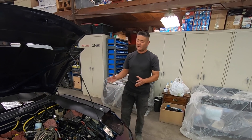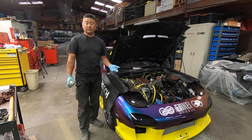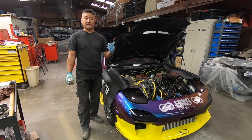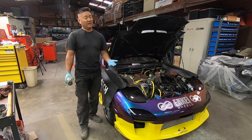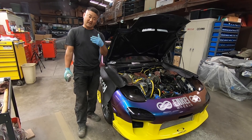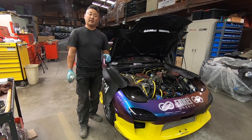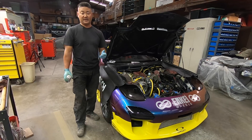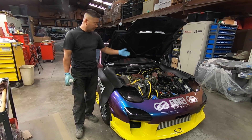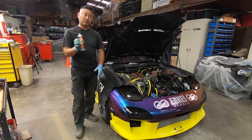Now what we want to do is go through the process of preparing to see if we can get the engine to turn over. The big question is: will the engine turn over? None of us know. In late night conversations, Abel and I have both theorized that maybe it will, maybe it won't. He thinks the engine is okay; I'm not sure I can't remember if it was blown or not. It has been sitting for a very long time, so Abel advised taking some sort of lubricant and spraying it in the spark plug holes, letting it sit overnight, then slowly turning it over. If we have any seals that have become stuck, it's going to become very apparent. The injectors being removed means we can also use the injector ports to inject lubricant.